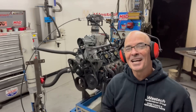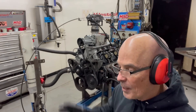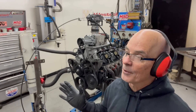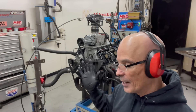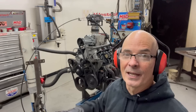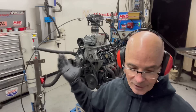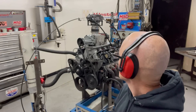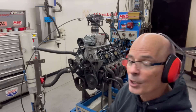It is alive! It actually runs with the carburetor on top going into the blower. We made a few preliminary runs and right now it's a little on the lean side — it's actually in the 13s — so we want to bring the air/fuel down by at least a full point. Right now it's not making a lot of boost because the pulley size is only giving 103-104 kPa, just barely sneaking into boost. We're going to do a jet change and see what happens.